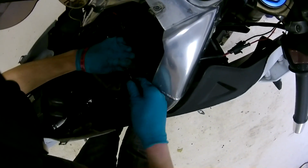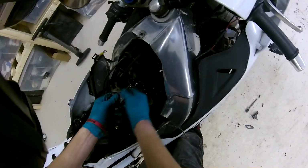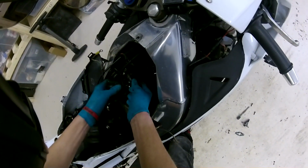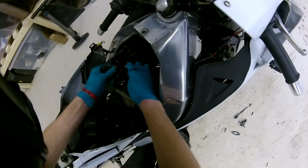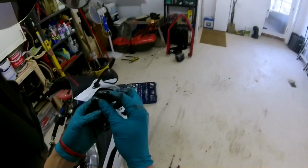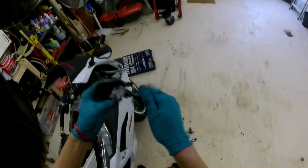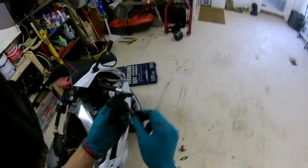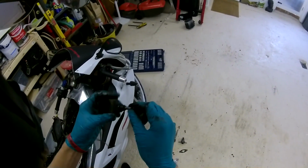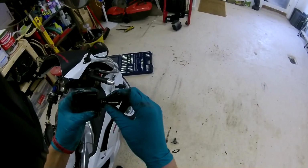And yeah, it looks like it's just worn, because look, that's stuck in there now, but it won't pull out all the way. So yeah, that's just a worn Powervalve. You can see where it's pushed the metal out. It's a bit of a shame really, because it's still in pretty good condition. All this carbon will clean off pretty easily. It's just a bit of a shame that's worn. It's about 70 quid for a new one of them.